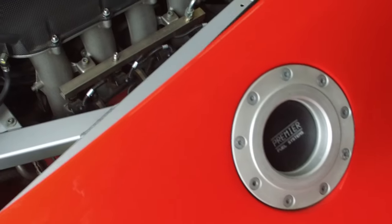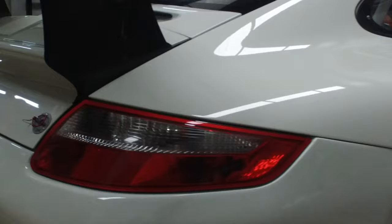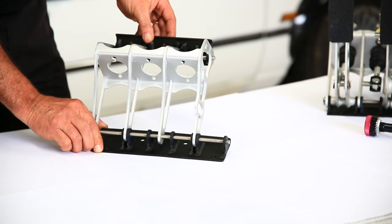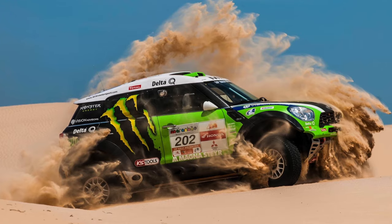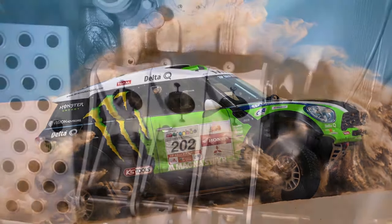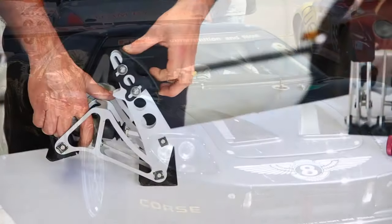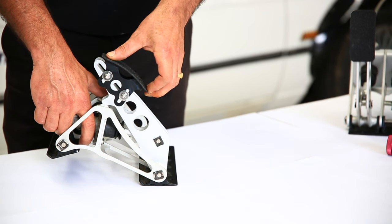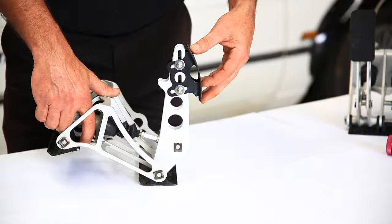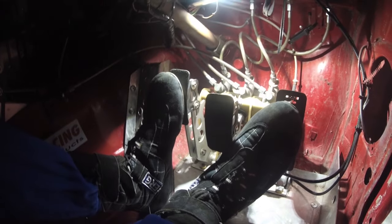Some cars would lose value if modified and we understand this, but with clever design we can reduce extensive floor modification and stiffening, saving time, money, weight and frustration. Many racers refuse to use floor-mounted pedals as they fear the possibility of fouling by debris. We have built in the stops high in the frame for this exact reason. By mounting the pedal box to the floor, there are other benefits — not only does it reduce the centre of gravity, but also makes for easier visual inspection and maintenance.